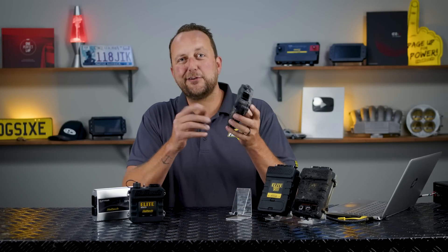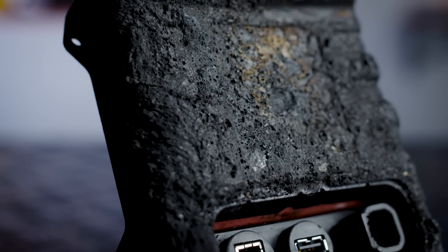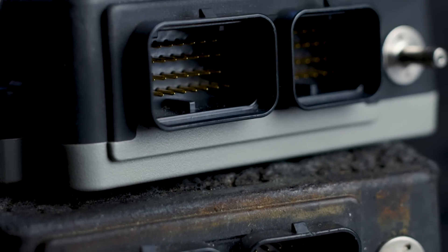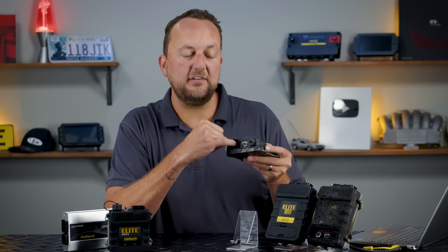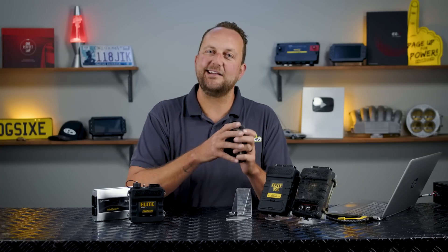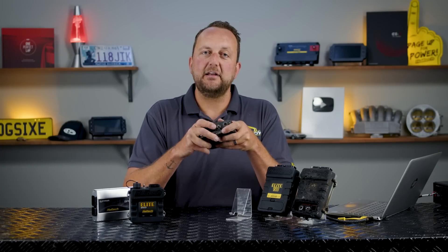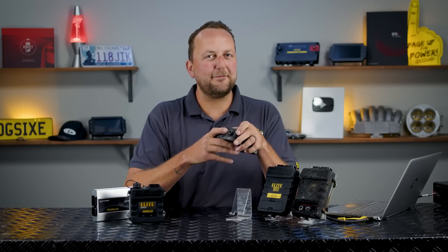The first thing to check is the visual appearance when you're looking at the engine management system. Something like this might turn you off at first, and the truth is I probably wouldn't buy this one — it's clearly been in a pretty bad fire, but does still work. Things to look at are the ECU pins inside the connector, just to make sure none of them have been melted from a serious wiring problem, or if the harness caught on fire and joined the power and ground together, melting any of the AMP pins on the engine management system. The screws that hold the ECU in place — make sure they look nice, they're not rusted, they haven't come loose or gone missing, indicating the unit might have been pulled apart at some point. Also, give it a smell. Burned electronics will have that funny electrical burning smell — if you smell that, walk away.